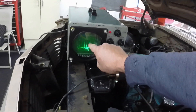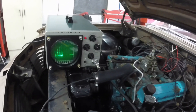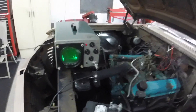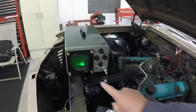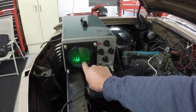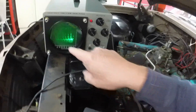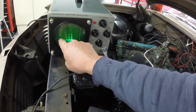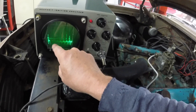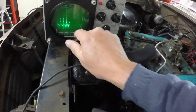If you suddenly accelerate the engine and you lose a spike, usually that's a lean run or vacuum leak or something like that. You can usually diagnose which cylinder you're having the problem with. This is in the firing order of the engine — one, eight, four, three, six, five, seven, two.